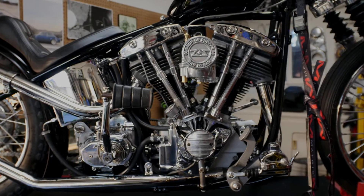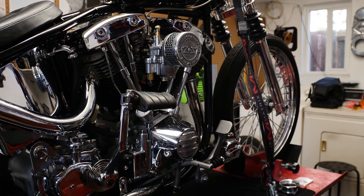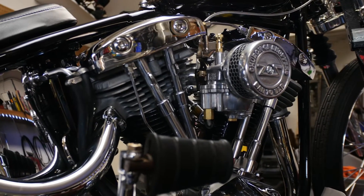Like with all my builds, I did a complete top-to-bottom engine rebuild — lower bearings, push rods, connecting rods, the crank was balanced, all seals and gaskets replaced, new cam, new lifters, oil pump, everything I could replace. If I'm going to be putting a lot of money into the bike, I at least want the engine to be solid for 10 or more years. Same thing with the transmission — top to bottom, all seals, bushings, gaskets, retainers replaced. The ultimate goal is to not have the thing leak.